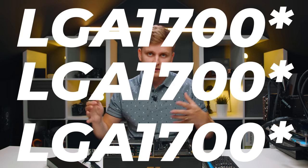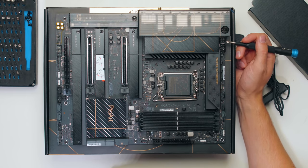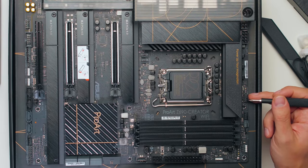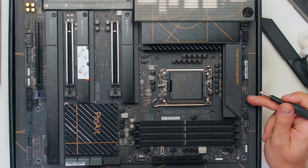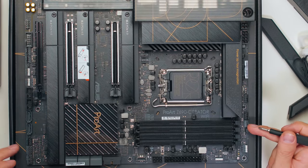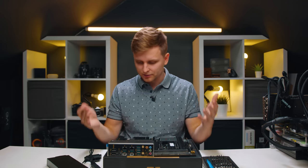So if you've got an old cooler and you just exchange a motherboard, you can use your cooler with the old mounting hardware. But the recommended way is still to wait for your cooler manufacturer and request the new LGA1700-compatible mounting system for optimal cooling performance. On the top over here you have your CPU power connectors — eight plus four. Moving around, there are PWM connectors — eight altogether on the board, all with the same 12-watt power rating. This one is the AIO pump connector, which always runs at 100% speed. You can configure the speed on all the other CPU fan and case fan connectors.